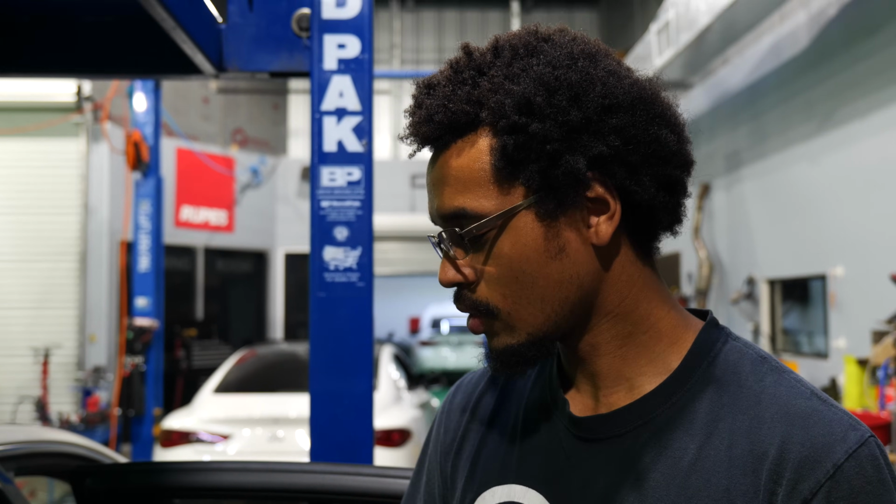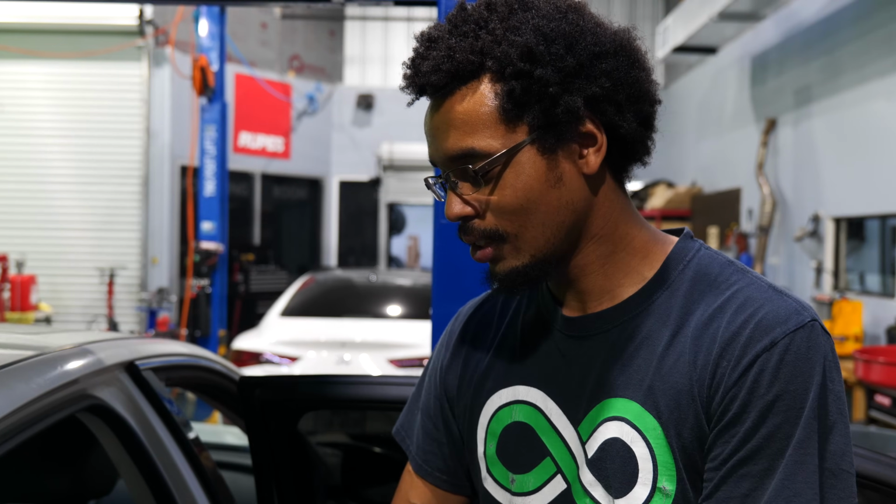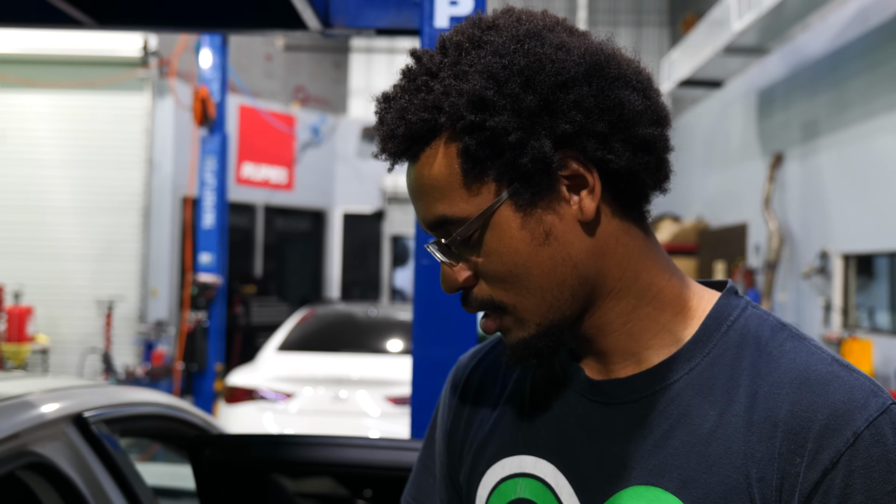They have instructions online, right, for this? Yes, so it's very detailed. There's two different instructions. You have an option for a single pump, and then you have an option for the dual pump. If you're doing the dual pump option, and you're not doing a return style fuel system, when you do the actual pump fittings, follow the single pump instructions and then add in the second pump. The install's pretty straightforward. It's a meticulous process. It's so much wiring. I think that's the most intimidating part.